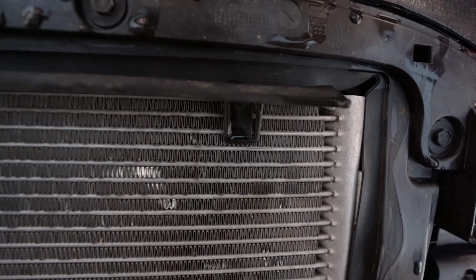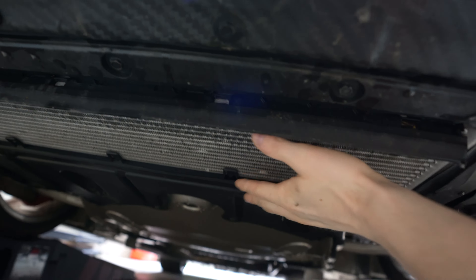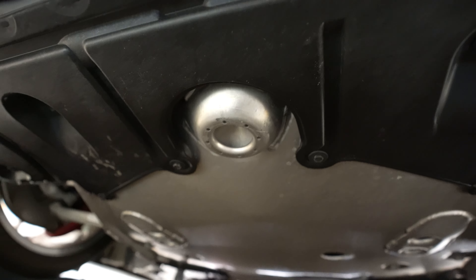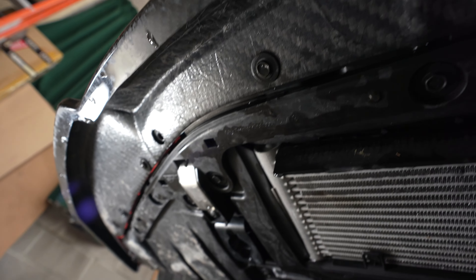I've got a couple more dents right over there too. As you can see, it's definitely beat up. Wouldn't it make sense for BMW to just from factory include some sort of grille guard or radiator guard? Way too exposed in my opinion. So it looks like we're going to go ahead and take off all of these 10 millimeters. For those of you also doing this install, you're going to want to get rid of this plastic piece that runs all the way along there.